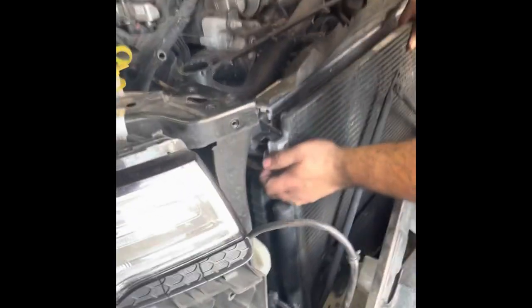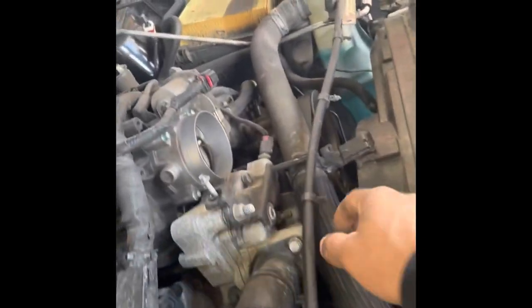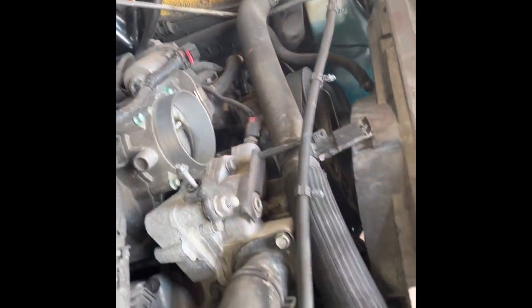So I'm going to get that off, and after that drain it out, and then you want to pull it out. Once you get to the point where you get the top hose off and the lower hose off, you can start kind of moving things around.